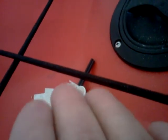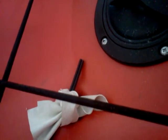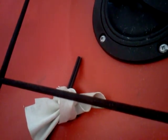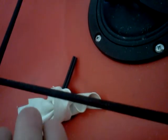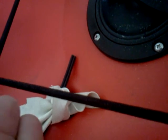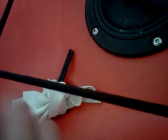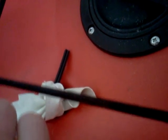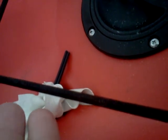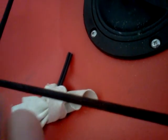That should hold it in place and reduce any water getting up through this bailing hole, also aiding in this thing trying to get on plane. Because when it pulled the stern down, a lot of water was coming up through here and that was enabling it to get pulled so far down. Plugging that bailing hole should aid in getting this thing on plane, because once it gets on plane it's going to be much more efficient, travel much easier, and there'll be much less stress on my arm to hold the motor in place.